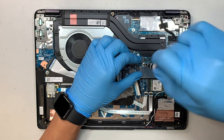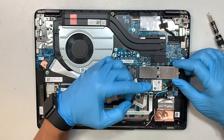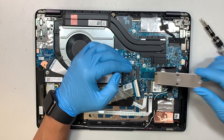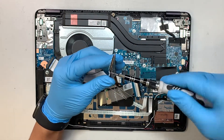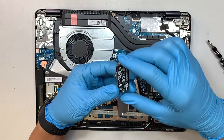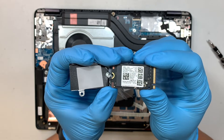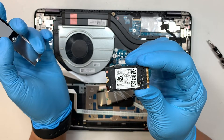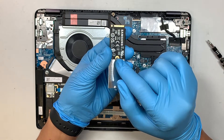There are actually two screws holding down the heat sink of the hard drive. Lift the drive up slightly — less than 45 degrees — then wiggle and pull it to your right. Note that this is not a full-size M.2 drive; it's half the size running at 512 gigabytes. You can see there's a small holder that holds the drive in the middle.